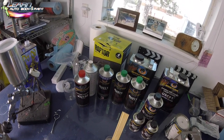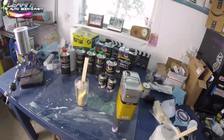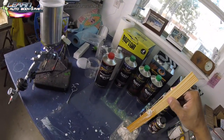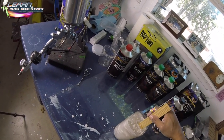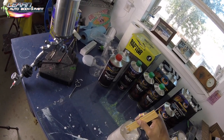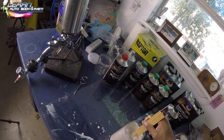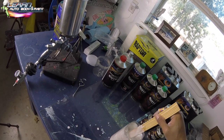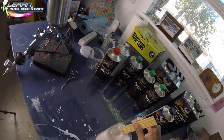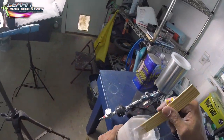You can eliminate this step if you're experienced — you could just mix your pearl or flake into the clear coat. But the problem with that is if you run it, you're gonna have a flake run or a pearl run, which is very hard to fix. You have to let it dry, sand it out, and reshoot it, because once you run that pearl or flake you can't buff it out or sand it out. You'll have to wait till the panel dries, sand it down, reshoot base on it, and redo it. That's the only downfall of mixing your pearl or flake into clear coat, so for a lot of newbies this is a great way to do it.